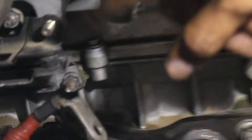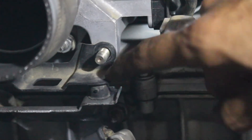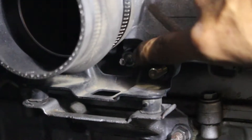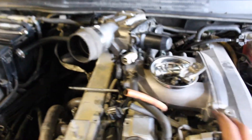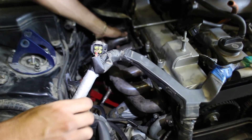There should be four bolts on the bracket — in our case we have two, and we forgot where we left one. After that, you're gonna move on to the nut in the back — it's a 12mm — that's the rod the throttle body moves on. Then you'll remove the 12mm bolts. Once you've finished taking off the throttle body it should give you enough room to take off the headers. You'll also need to disconnect the cooling hose and the plug connected nearby. I also disconnected the harness and moved it to the side for more room, and now we'll get to the bolts to demonstrate how to take out the headers.